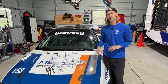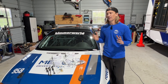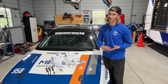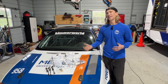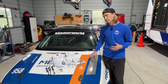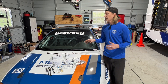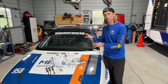Back in the home garage going to do a little work on the old Spec E46. Got some AiM add-ons that I'm going to tack on to my Solo 2 DL. The Solo 2 DL is a super strong tool out of the box - at its core it gives you GPS speed, benchmark lap times, and predictive lap times. On something like an E46 you can also get sensors transmitted across the CAN network, like throttle position, oil temp, and water temp. However, there are sensors I may want that are not transmitted across the CAN network, so this package allows me to add external sensors to the Solo 2 DL.